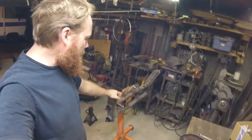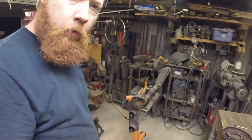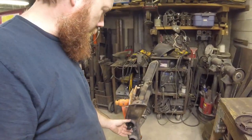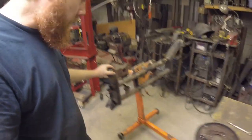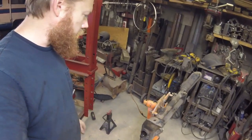Day 7 was the most productive so far. The beam is almost completely disassembled. Tomorrow first thing, I'll pull these torsion bars out of there, clean everything up, degrease the beam, and it should be ready to go. I've already done everything else on the beam, and chased some threads and paired some bolts and so on.